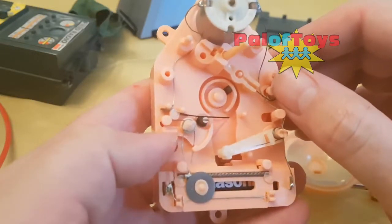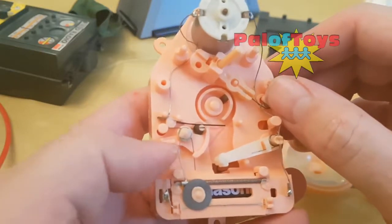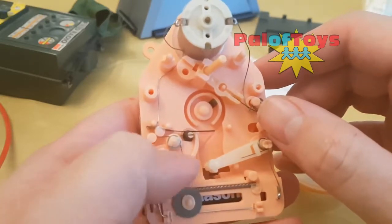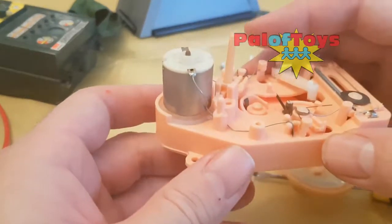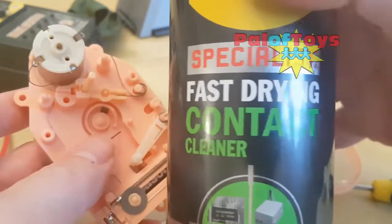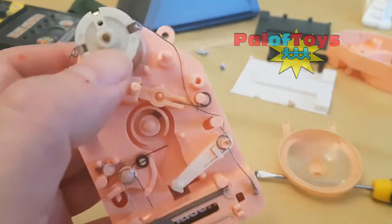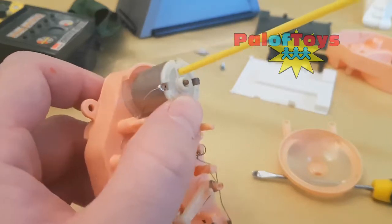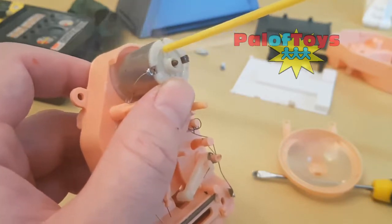I still can't work out or remember why that little hammer piece is there, but I know if it's not in place the circuit doesn't work as expected. I thought when it was pressed up it nudged that switch to break the circuit, but clearly it doesn't. As usual with these things the best thing to use in my experience is WD-40 fast drying contact cleaner, because after a few years this motor will have seized and just gunked up, so I always get plenty in there.